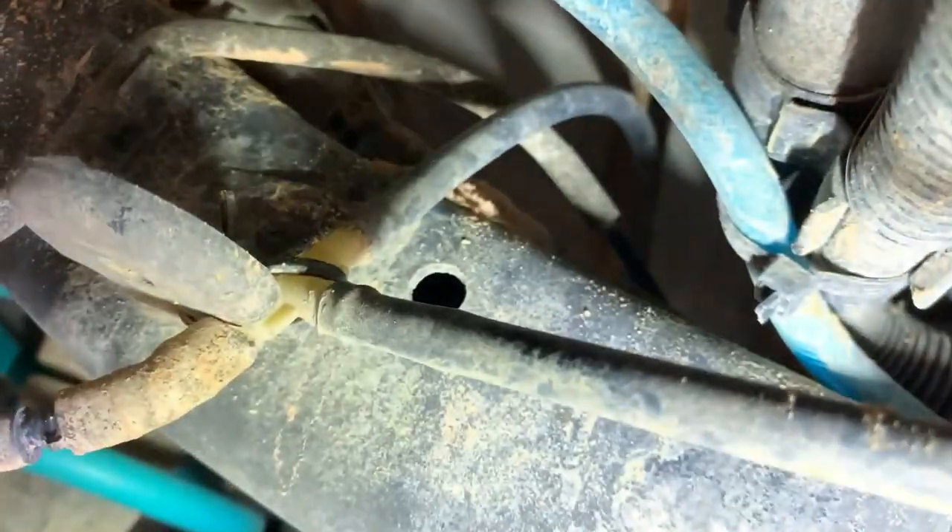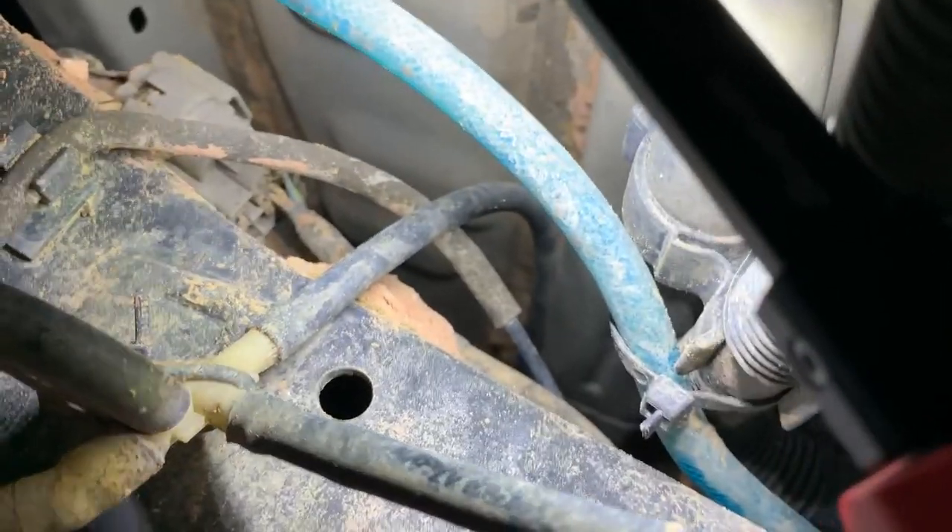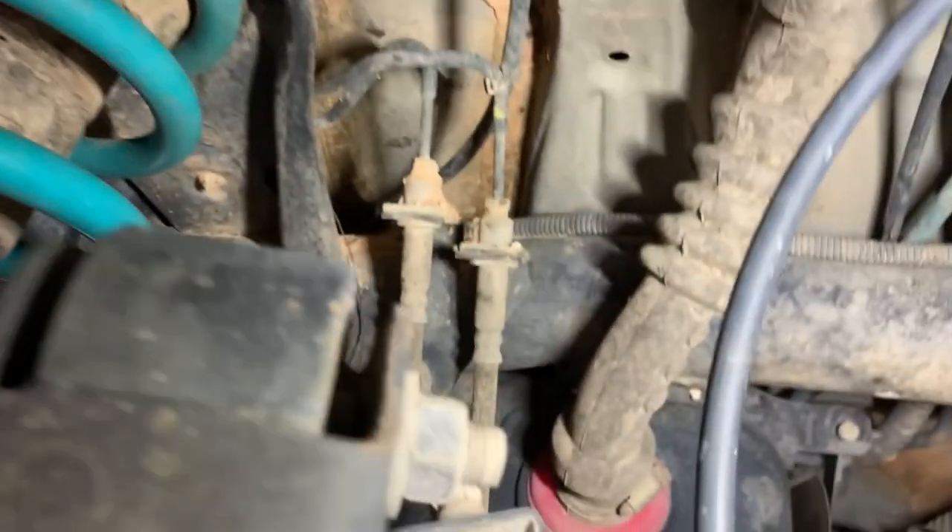What we've done here is mounted both of these breathers to a T-intersection — a vacuum line fitting — and then run a line up and over the fuel tank, through the frame, all the way to the front of the vehicle. So we only had to do it once.